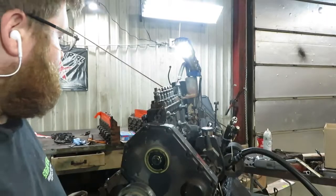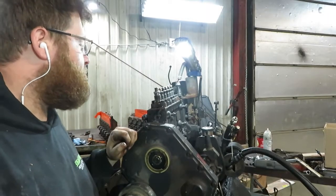But we're not leaving this one at 14 degrees — we're going to bump it up. I'll pull the timing pin out of the pump since it really has nothing to do with what I want to do. I'm going to remove this delivery valve holder here, pull the delivery valve out, and I have a dial indicator that I put in there to get it to the lift that I want.